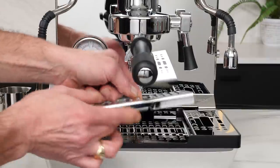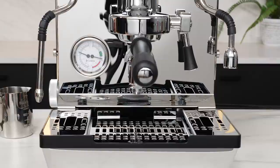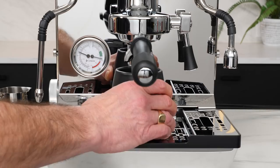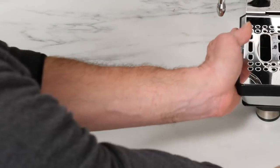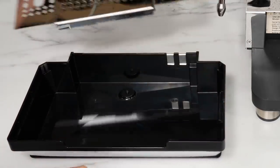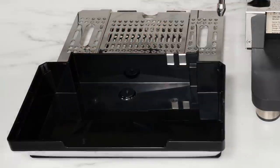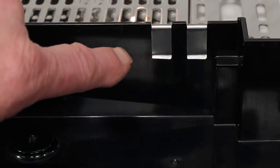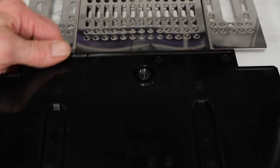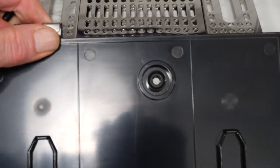The large surface of the drip tray is unique and great for both home and commercial use. It has a removable platform for a scale giving more clearance for taller cups up to four inches. Volume in the drip tray is really big at 1.9 liters, good if you won't be running it to a drain line. The drip tray is electrically monitored by contacts, so you'll get a warning in the display when it needs emptying. When the tray is full, brewing is locked out until emptied so there's no chance of overflow. If you do run to a drain line, the tray is pre-drilled, set up with a collection cup underneath, and comes with a drain line.